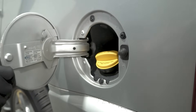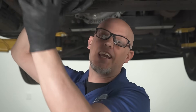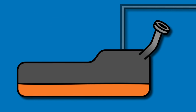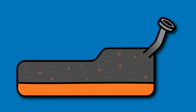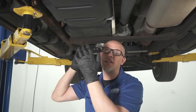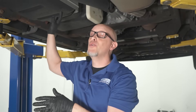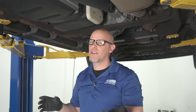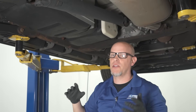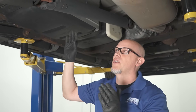Nice quick and easy fix. Next we have the gas tank, which everyone knows is gonna hold the gas. But in that gas tank, while the gas is in there, there is fuel vapor, and the whole purpose of the EVAP system is to keep that fuel vapor from escaping into the atmosphere — so it needs to be a sealed system. When that system isn't sealed properly, that's when you're gonna get your check engine light. For the most part, the fuel tank isn't a common area where you're gonna have an EVAP issue, though there could be some sealing issues on top or rust buildup, but it's not that common.